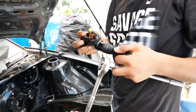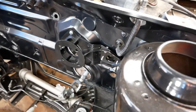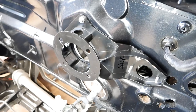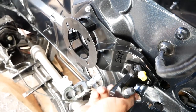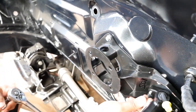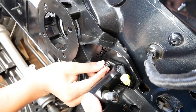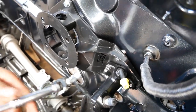Mark is working on the master cylinder for the clutch, and we're going to show you how to install that — it's probably the easiest thing you're going to do. Once you've got the bracket nicely mounted and tightened down, there are two studs that stick out of the bracket on the right. The master cylinder goes right side up on those studs. They provide you with a nut and washer on each side — those are 10 millimeters. Tighten that one down first to give you more thread on the other side.